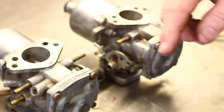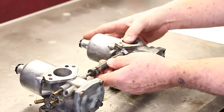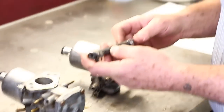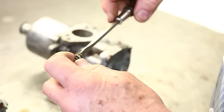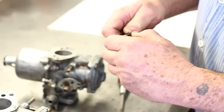So you can change the line from the fuel filter to here — that's easy enough. And you can change the line from here to here with just a piece of quarter-inch fuel line and put clamps on it. Done. But what happens if you're Mr. Original and you want to make it look nice? Now you can order a new piece of hose, absolutely, that's got this nice steel mesh on it. Or you can do this.